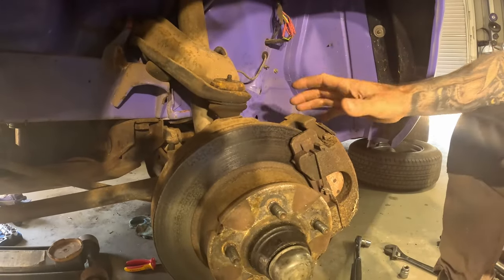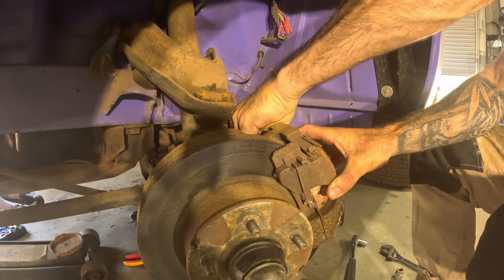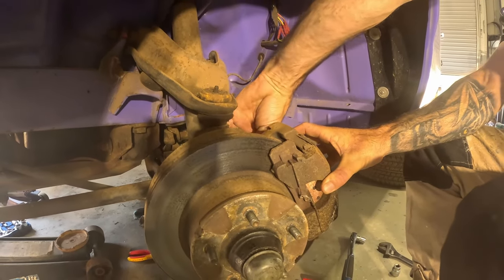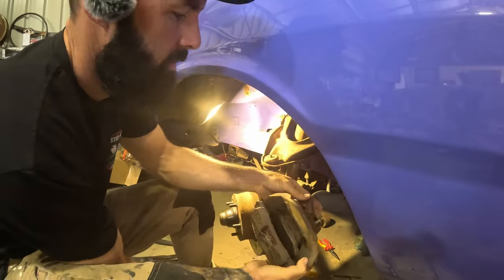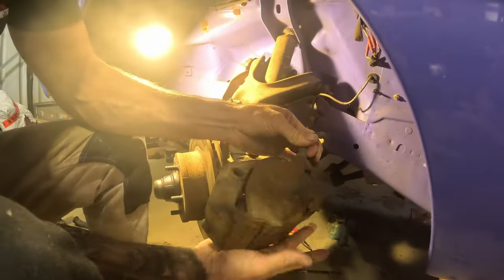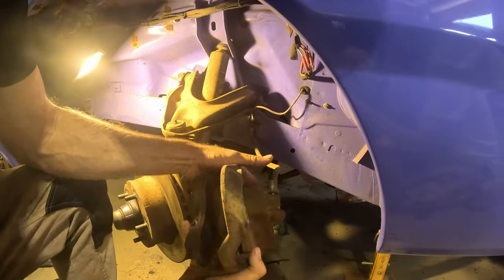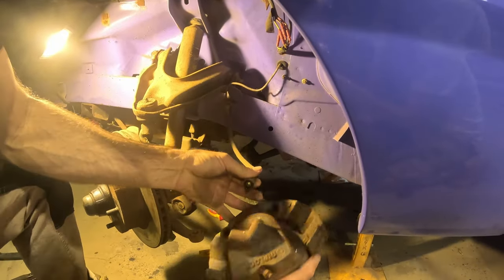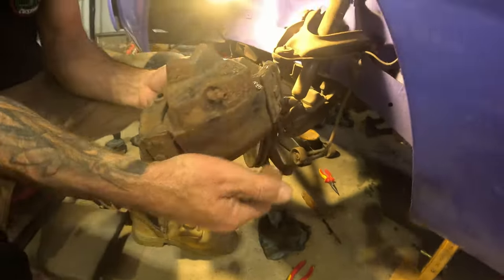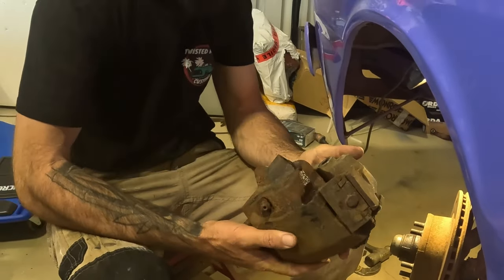Let's get started on this side. First, I take off the brake caliper — it's two bolts in the back. Yours will be somewhat the same, similar process but might be a few different bolts or locations. I've already done the brake line to this and we're just going to undo that line going into the caliper. It's going to drop fluid everywhere — make sure you don't get it on your paintwork because brake fluid is very bad for paint. I'm going to let mine strategically dribble on the floor. That caliper will have to be sandblasted because it's got a lot of rusty surface on it, so we'll give it a sandblast and a fresh coat of paint.